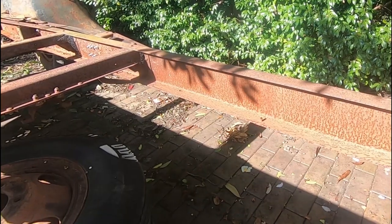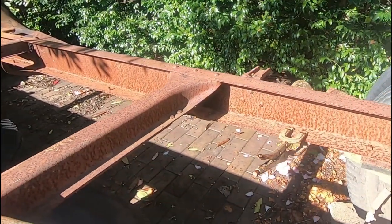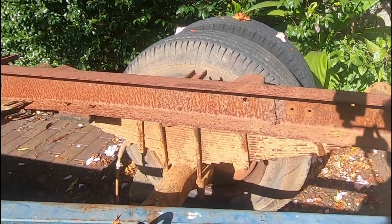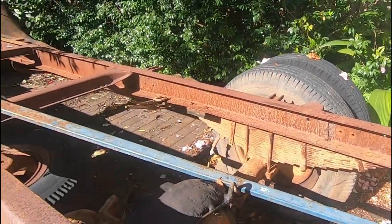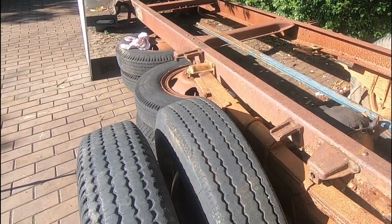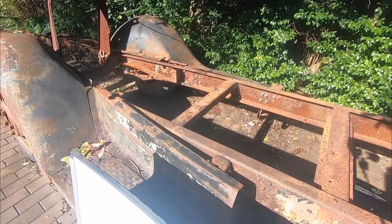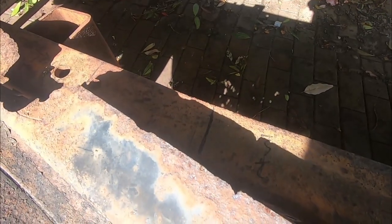And as we touched on earlier, one of the issues with this chassis is that it does taper and become smaller towards the back, which is where we want to mount our springs. So this created a further issue, which means that in order to get it past engineering, we need the entire chassis to be parallel the entire length. Now we do still have the 36 Dodge chassis off to the side, and that's where it's going to now come in handy. If we have a look at this mark here on our 35 chassis,